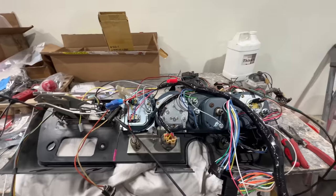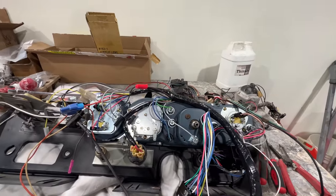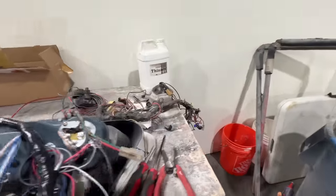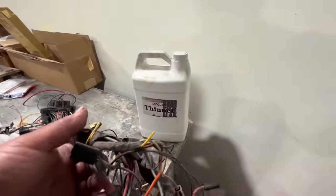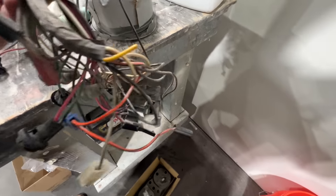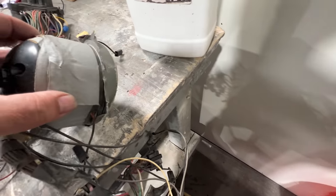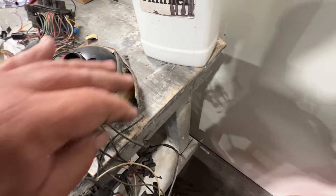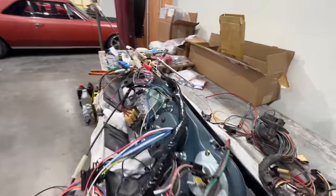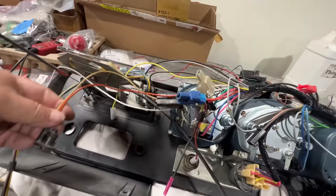While you're in here, make a note — go ahead and change out all the bulbs, because you don't want to have to go through this again. It's a bear to get your hand up behind there. Also any wiring — look at this, this is the one that came out. You can tell all this was done with somebody laying on their back and reaching under the dash, just irritated. There's melted wires in here, burned-up wires, wires that are just cobbled together and twisted up. There's cardboard and duct tape — this duct tape isn't even duct tape anymore, I don't know what it is.